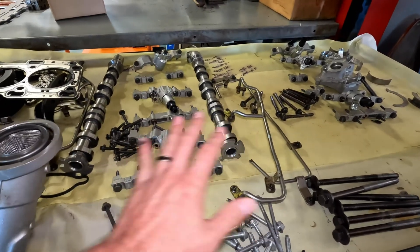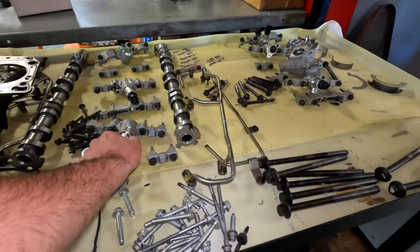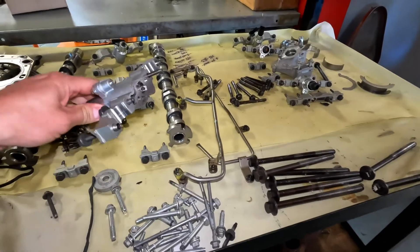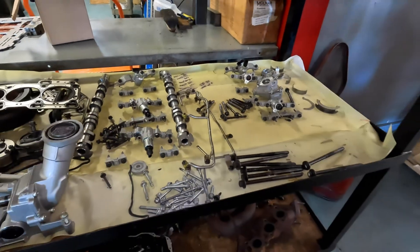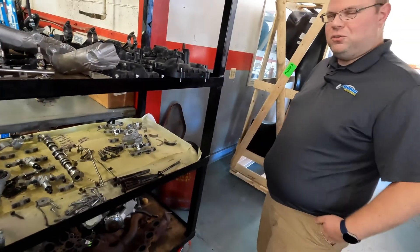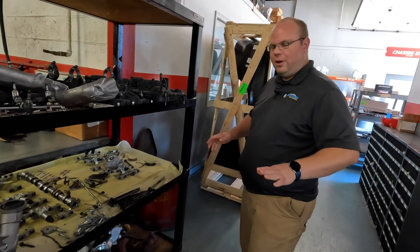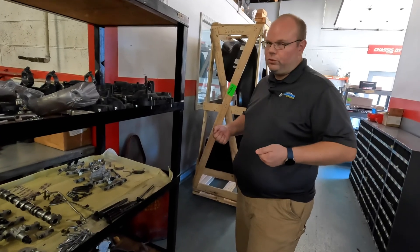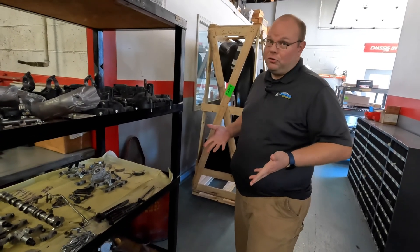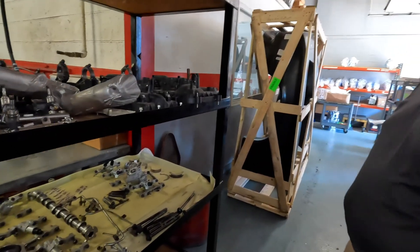It's crazy how all this works in the cylinder head. You have solenoids that are actually the cam caps themselves. There's also a separate bottom carrier for the cams now — so if you end up toasting the cams, the heads aren't junk, just the carriers are. That's actually a good thing in our opinion.